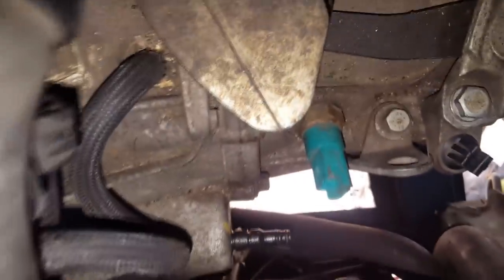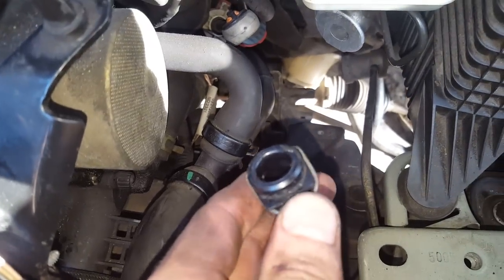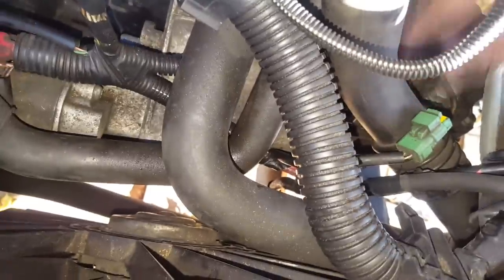Well, next, here you can see this is for my main reason, the clutch. So maybe let's start with this piece. Maybe I didn't show you before, but this pin, you don't have to remove it, you just have to press it in, and now when you press it in, you can put your clutch cylinder on top. Here the clutch line goes through this connector, and then there's one more under there. Probably you don't see it, but so I fit back the clutch here.